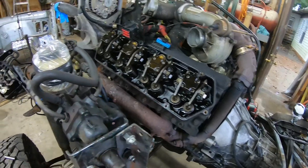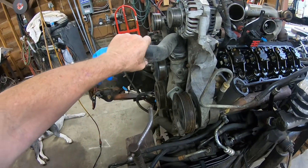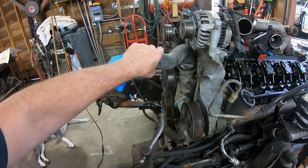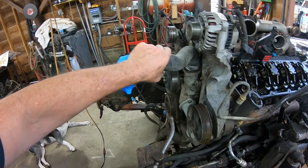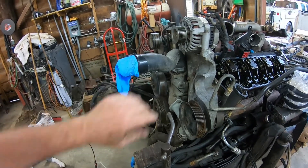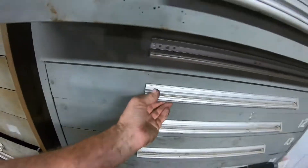The thing will blow all the coolant out of the system. It's happened to me a couple of times, so now as a check — what I've noticed is that it will show up the next morning. When you come home, everything still seems fine. But the next morning you start the truck up, warm it up, and you don't have any heat coming out to defrost. Then you come out, grab your radiator hose — normally you should be able to squeeze it — but the radiator hose will be cool and hard.